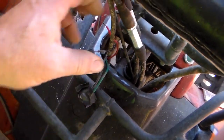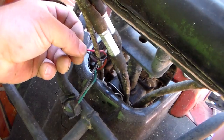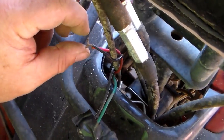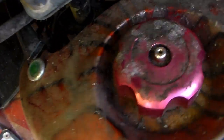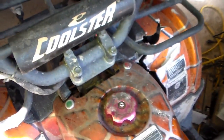I tape these up because it's annoying to be driving around and have it turn itself off. Remember, this red wire is now at 12 volts, so if it touches ground anywhere it's going to blow the fuse. Now I've hooked those together — the green light is on, so I have power to the system.